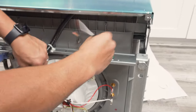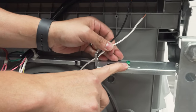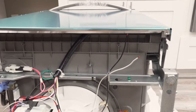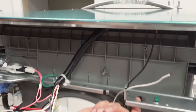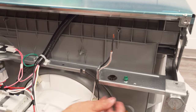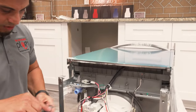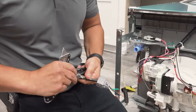Inside you have a white wire and a black wire, and a green ground screw. If you're hardwiring your dishwasher, you're going to run the hard wire from behind the dishwasher through this hole here, giving you access to secure the lines. Make sure you use the clamp so those wires aren't loose and won't ground out. I'm going to go ahead and do the power cord installation, which is exactly the same process as hardwiring — just with a power cord instead.